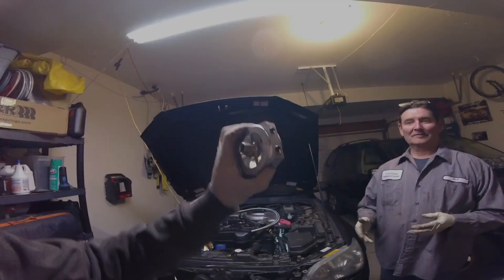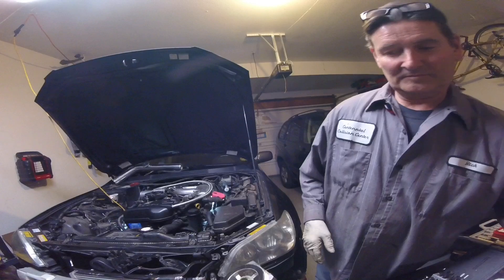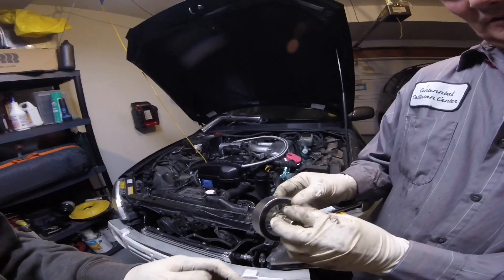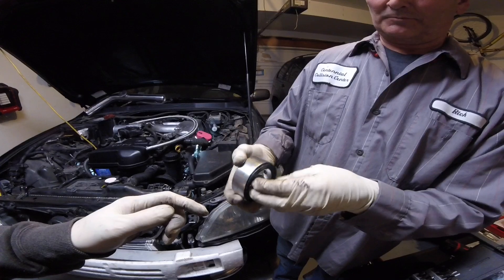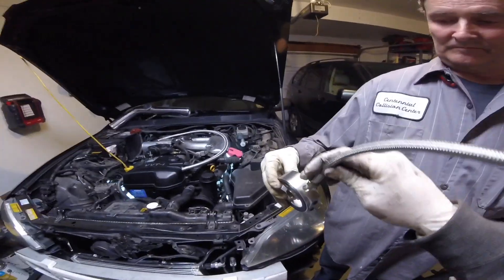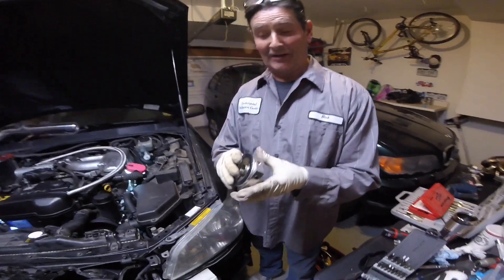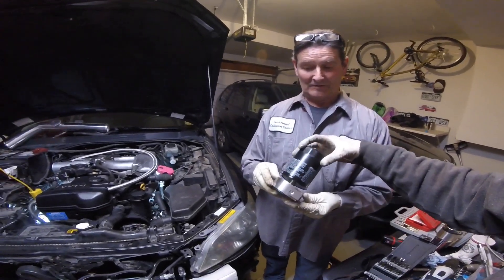Get a wrench. So this is our oil port for our oil feed line. This is actually going to be — we just had to press this fitting into the center. The easiest way to do it was to screw this other one into it and pull it within itself, and then we were able to tap it in the rest of the way with a hammer and a block — basically put a socket on each side of it and kind of tightened it into this fitting here. Obviously some grease. And then we're going to put this where the oil filter goes and feed this oil feed line right into the side of that, which is going to be a major episode just trying to get that in there because it doesn't swivel — you have to turn the entire hose with it. And then the oil filter will just screw onto the exterior.